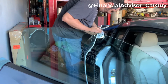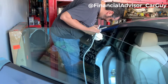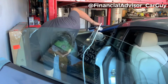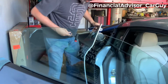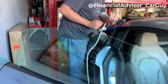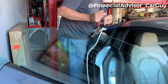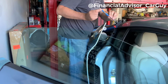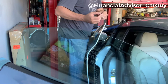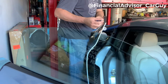Now the electronics part, as I mentioned. So the electronics part looks like it's the same T27 bolts or screws that I had on the other deal, on the blade themselves. So what I had done when I removed them from the blades is, you can see this, I used this blue painter's tape to secure my extension to keep it from disconnecting. And then my adapter bit to keep it from disconnecting. And then I was actually taping the screw to the bit itself for easy removal without having it fall off